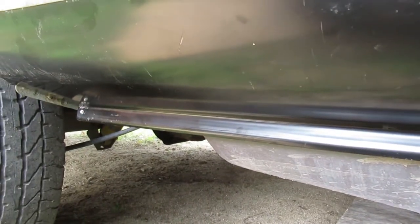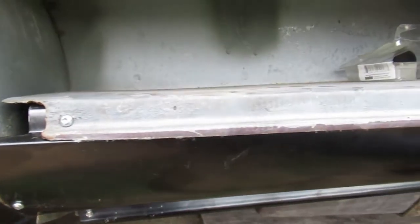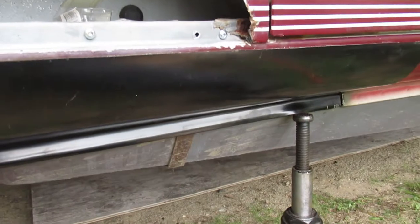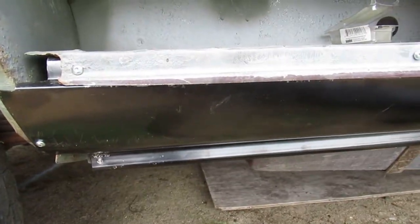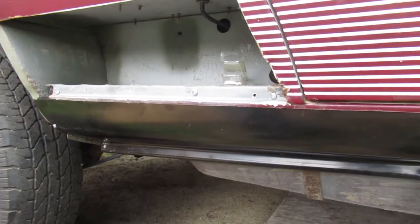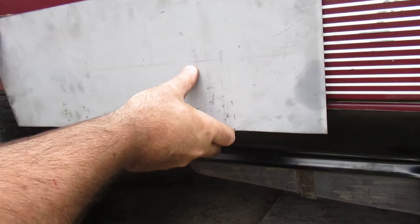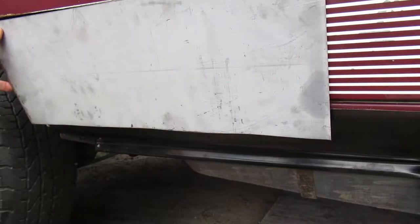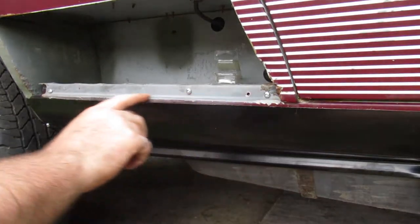I have to take this piece off to drill the holes for the plug welds and do a little painting to protect it as best I can. It's a summer-only vehicle — people need to consider that when buying a camper. I ended up using a jack to force the thing into place. There's a drip rail I need to ding back into position. I'm pretty happy with how it's turned out — the welding might be trickier since I haven't done much sheet metal welding.